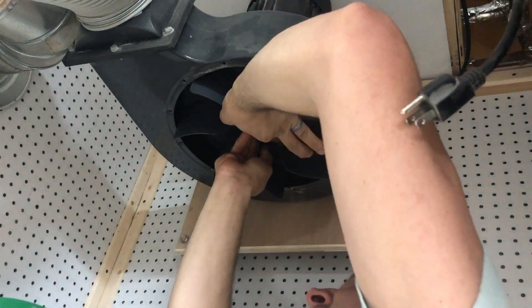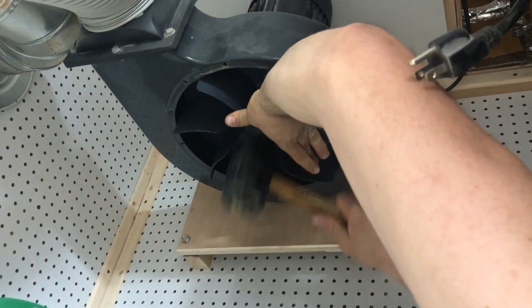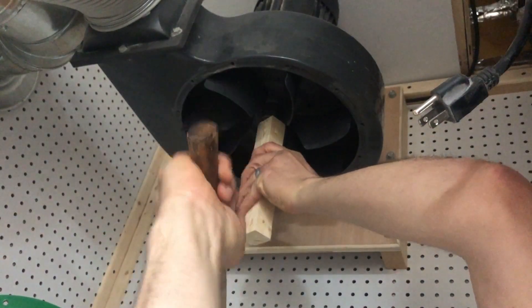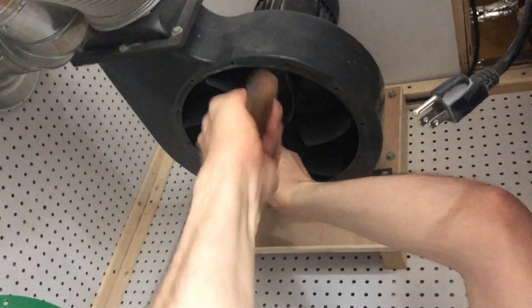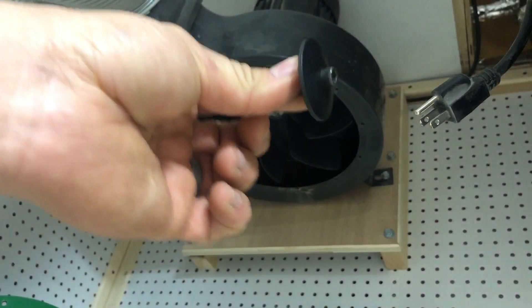All I have to do is align the mark on the spline with the opening on the shaft and press everything together initially. After double checking that everything's aligned, I'm now going to use a rubber mallet to gently tap the impeller in place over the shaft. Because the surface you're pounding on is flat and recessed, you have to finalize seating the two surfaces with a wooden block.